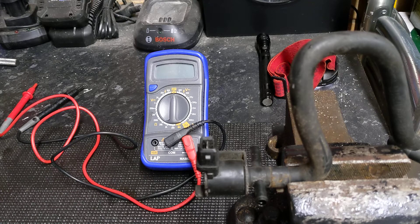We're having some over boosting issues, and my understanding is if you're having issues with your boost levels — whether you're under boosting or over boosting — along with a boost leak test, an N75 test is a good place to start.